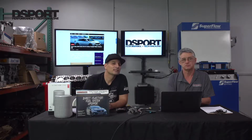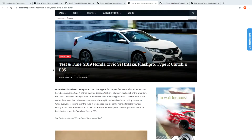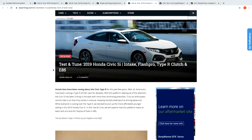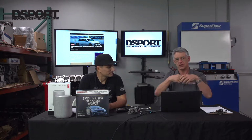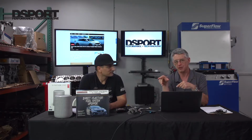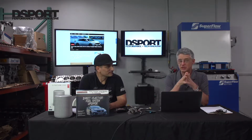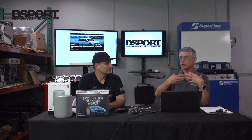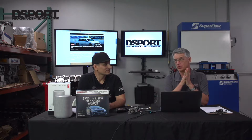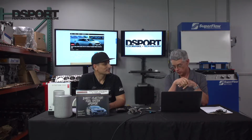Go ahead. So on the Civic Si, at what power level do you need to upgrade the clutch? Back to basic engines, it's not power, it's torque. Torque is the twisting force, okay? Power is simply torque multiplied by RPM. So from our own test purposes and our own dyno, which is close to flywheel torque, I'll give you the flywheel torque numbers: we found the clutch starts slipping around about 260 to 280 pound-feet of torque.